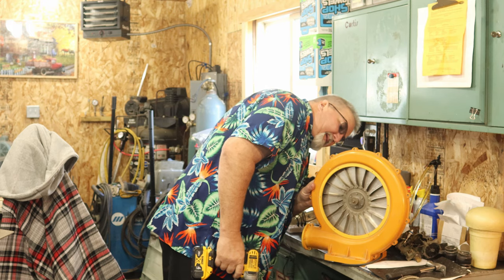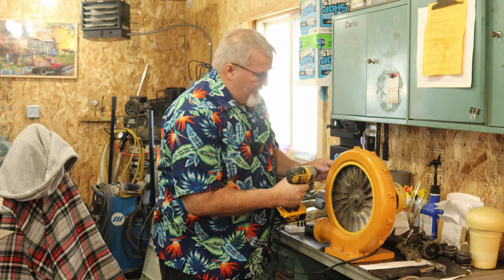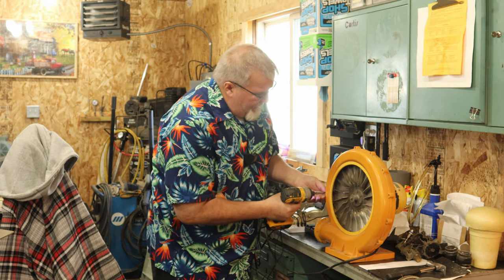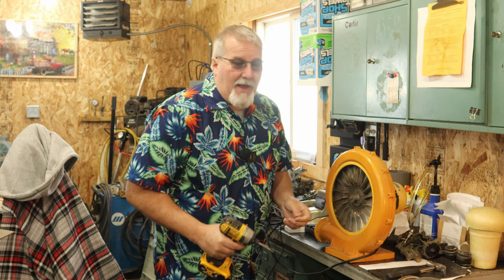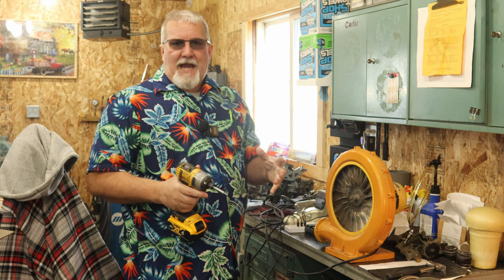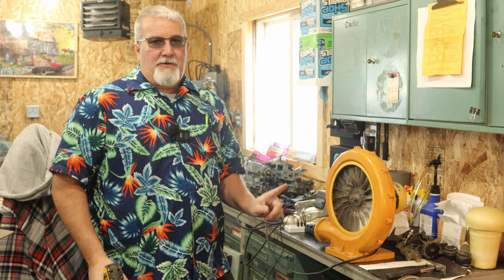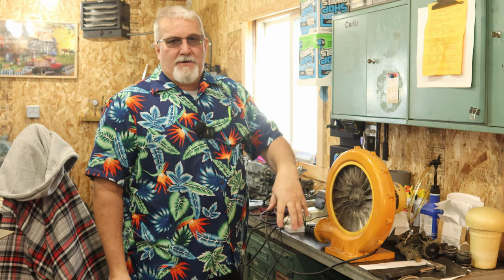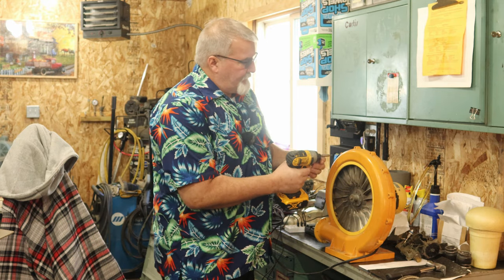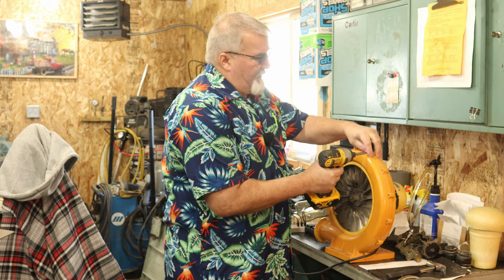So now, in order to get the motor off, I've got to take this cover off. I've got my handy dandy little magnetic tray here, but I won't bore you with all this. Once I get inside, we'll see if we can access that bearing. Maybe I can just buy another bearing. I do have another little 320 CFM blower coming that won't pull quite as much air. I have a feeling the problem with this blower is it pulled so much air that any moisture that would splash up into the tube, even though I had the tube going up and over so the water would just drip back down, it pulled so hard that it would blow it outside and fill everything up with water. I think I just had too much power. But time will tell. That won't be here for about another week.